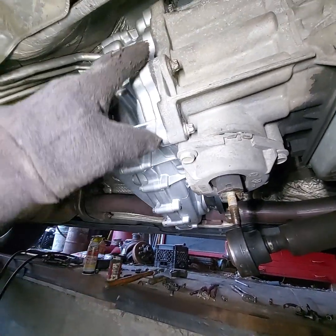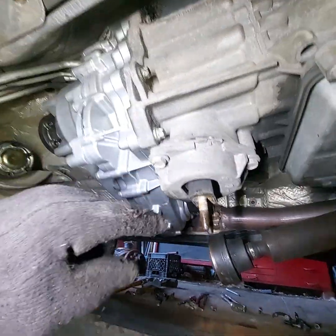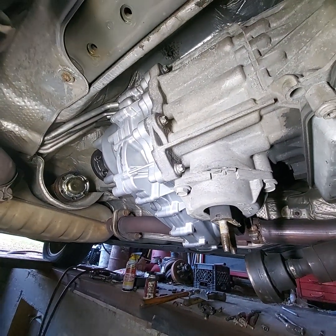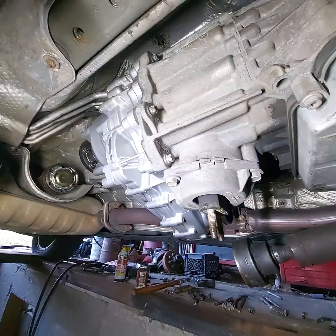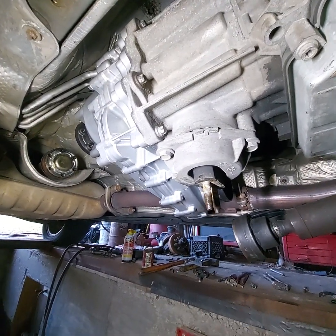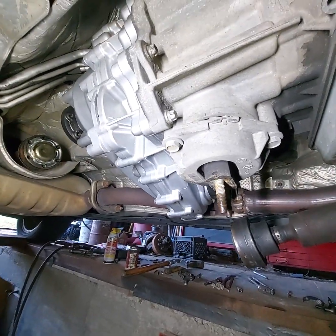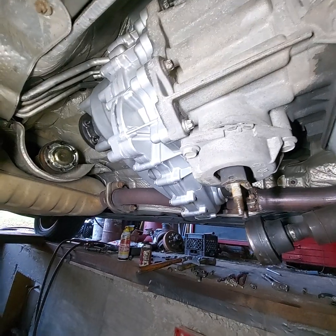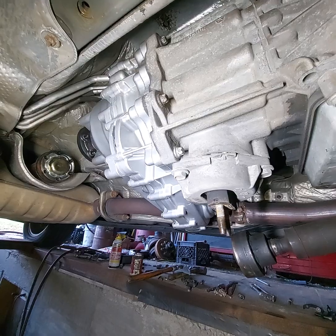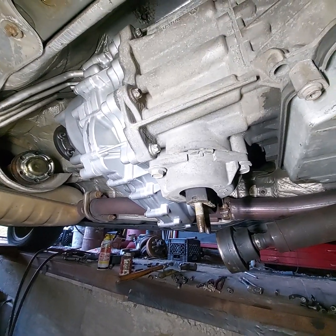And once you've got it contacted or fully seated, then you can go around and start tightening them up. I don't know what the torque spec is. Good and tight. It's just a 5/16 bolt. The shank, you know, they're not head bolts, and they're just going into a cast aluminum. So I don't know what the number would be. 40, 50, probably somewhere around 35, 40 foot-pounds, but just good and tight, you know, dadgummit. Don't get out your 1/2 inch impact and pound them down.